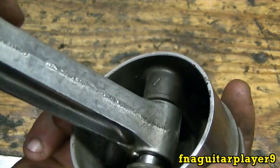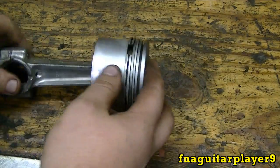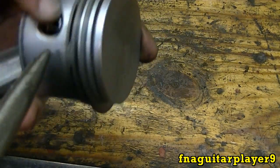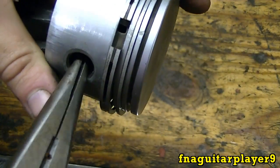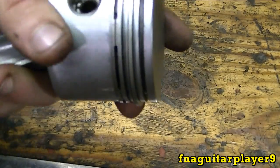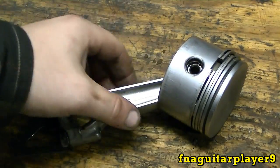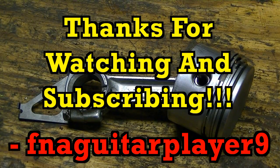It's normal to have some play in the rod because your end play is set by the crankshaft in your engine. To put the clip back in to hold it — don't forget that — you want to get it started like this. This can be tricky sometimes, and watch your eyes because it's possible for one to sling out. I like to go in there and turn it a little bit with the pliers and pull on it just to make sure it's in there all the way. Well guys, if you have any questions or comments feel free to leave a comment below or send me a message and I'll get back to you as soon as I can. Thanks for watching.